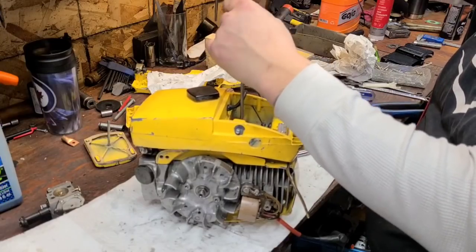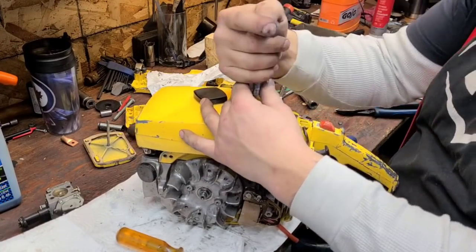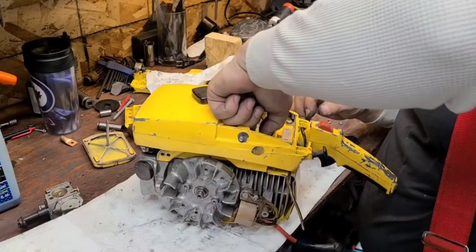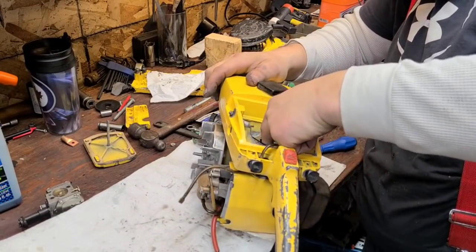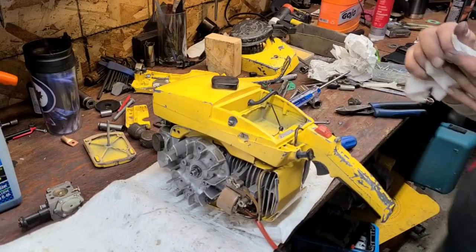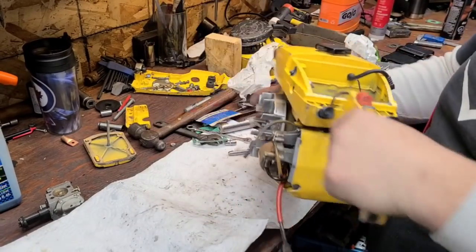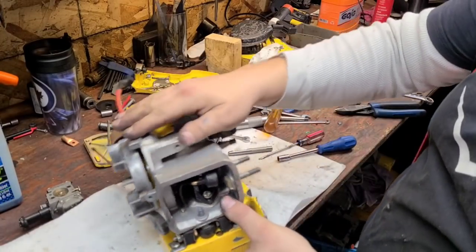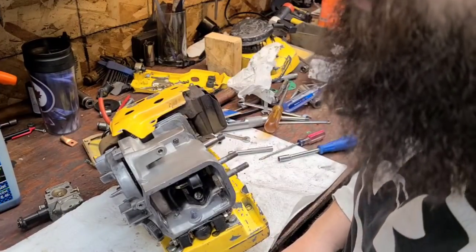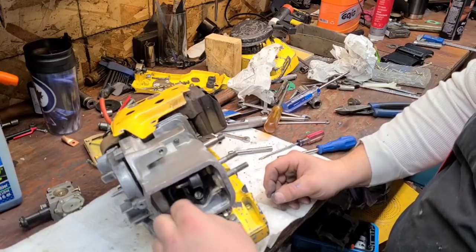Skinning is when you let it dry. Some gasket maker says to let it skin — which lets it dry just a little bit, sometimes five or ten minutes. I'm just going to stick my finger in there and get rid of any gasket maker that's pushed its way out. We don't want any obstructions in this saw; we don't want air getting right in there. So, two flange screws and your two mount screws. Now we go to the front — there's a nut and a washer here somewhere.